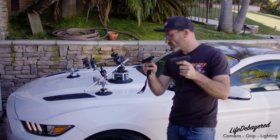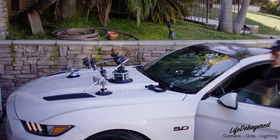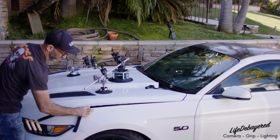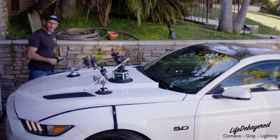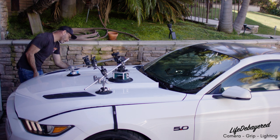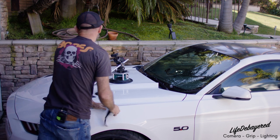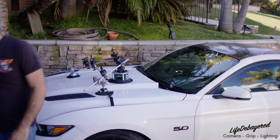In your kit you're going to have two hood securing straps. We're going to open the hood slightly and place the securing straps inside the engine compartment, do the same thing for the other side, and then close the hood. These straps now present a secure place to connect the ratchets and hold the whole system down.